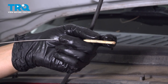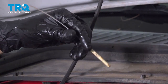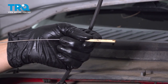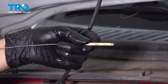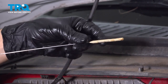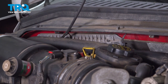I would also recommend waiting about 5 to 10 minutes after you fill it because the dipstick tube is going to be covered in transmission fluid. As soon as you dip this down in, it's just going to get smudged and you'll get a false or inaccurate reading. So wait 5 to 10 minutes, run the truck, drive it around if you can, and run it through all the gears so that all the solenoids get filled up with fluid — then check it. You're aiming to be within the hash marks. When you're done, put the dipstick back in and take it for a test drive.